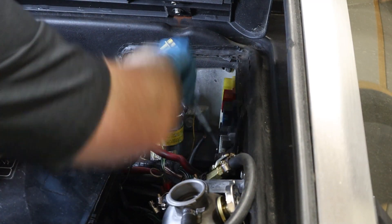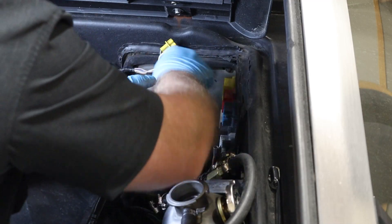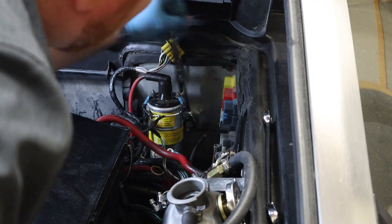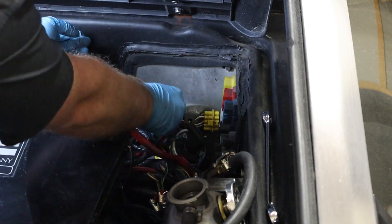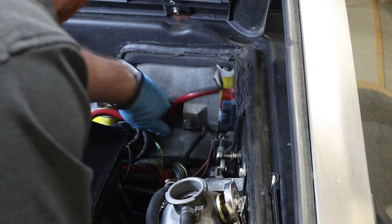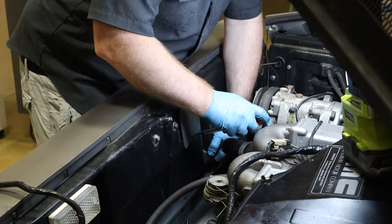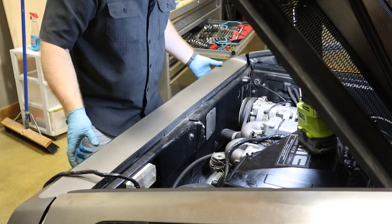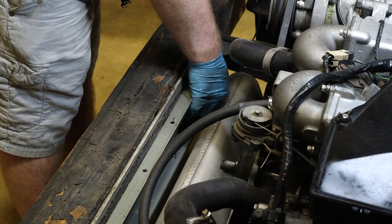Before removing the fascia, I disconnected the wiring harness that goes to it and went ahead and disconnected all of the harnesses while I was in there. There's also the main battery positive cable that connects there as well. Then this is the ignition coil, so I find the right wrench and take that off. And then there's the jump start post that connects straight to the battery, and that comes off too. I forgot to remove the engine cover latch cable, so I open up that little plate and disconnect it, then pull the cable out and remove the fascia. On most DeLoreans there are a few more nuts and bolts that hold the fascia on the bottom, but they're all broken on my car, so it comes right off.